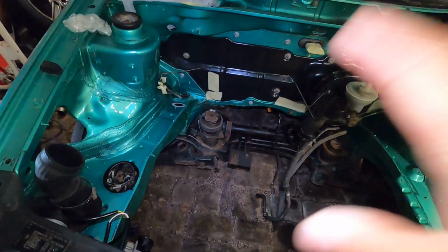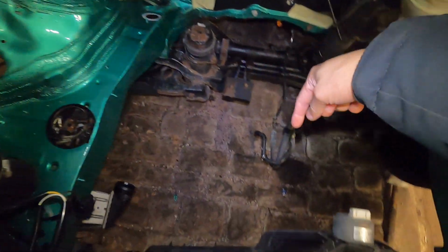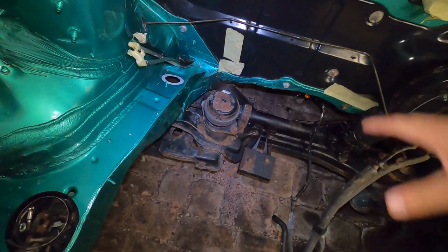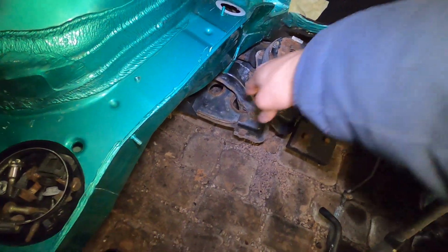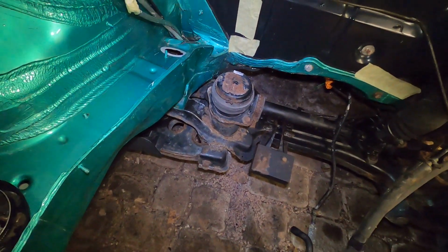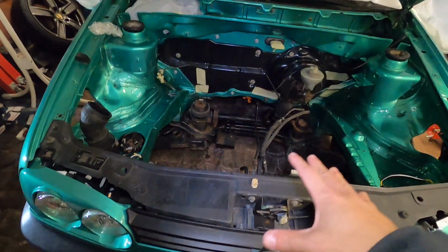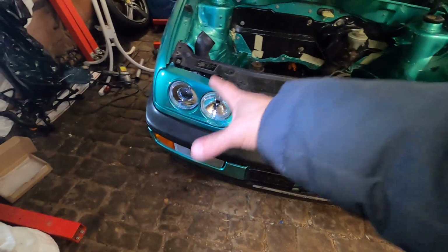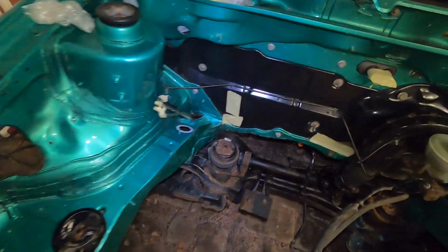But as I've seen, because the 1.8T has the mounts here and here, where the Mark III has the mounts in the back, the front, and over by the trans, if I have that pipe going down to the turbo, I don't know if it's gonna clear the mount that has to go right here. You see this pipe is right here, so it'd have to go from here to about right here basically, and there's gonna be a mount here. So I'm not sure if that's gonna fit exactly, or if you get someone to make you a custom pipe, it probably would. But if you have a 1.8T swap and you are running a same side intercooler or a side mount where you have a factory style routing system here and there, what did you do for your rear mount?